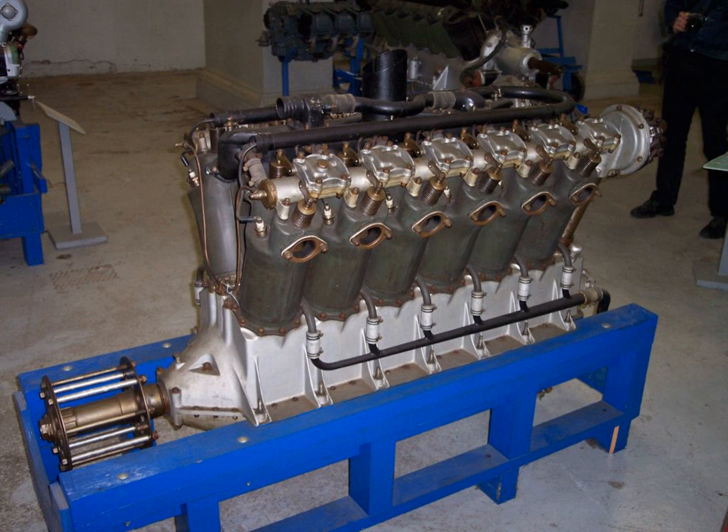A further Mark IV variant increased the power to 410 hp by increasing the governor limit to 1,700 revolutions per minute, and by fitting a new intake manifold and carburettor for the Cavalier tank. Mark V was a redesigned engine producing the same power as the Mark IV but for use in the Centaur tank, revising the oil distribution and remaining governed to 1,700 rpm. The engine was intended for the Cromwell tank, but the Liberty-based design was dropped in favor of the Rolls-Royce Meteor. Those tanks fitted with Liberty were renamed Centaur, and production was split.